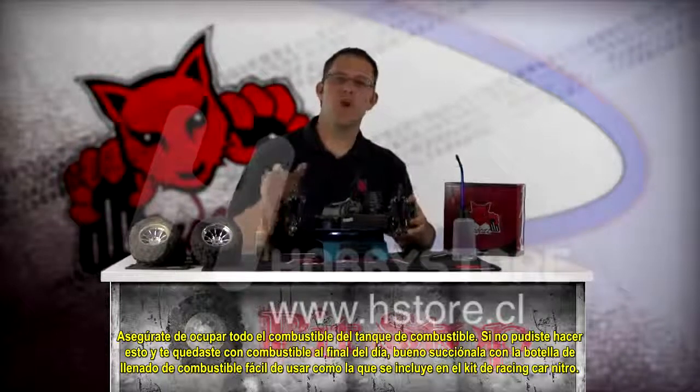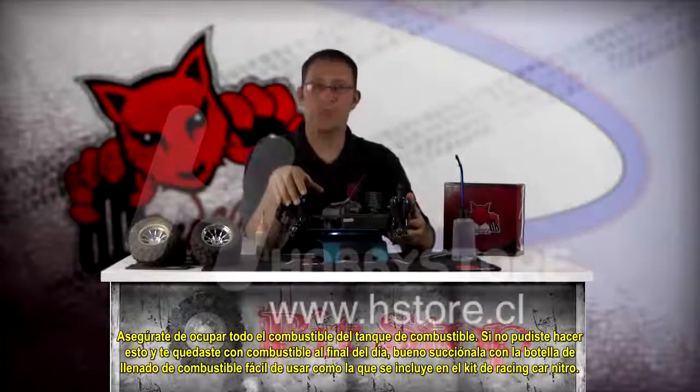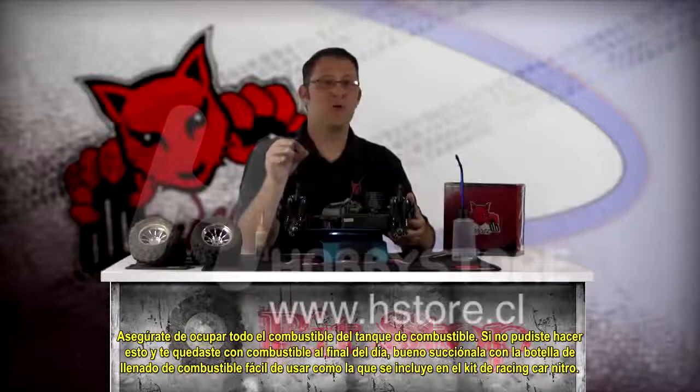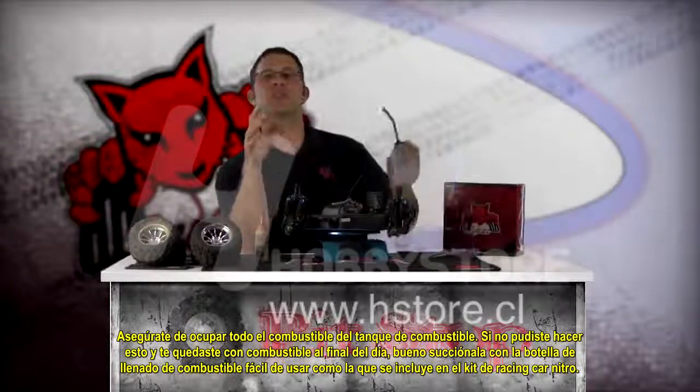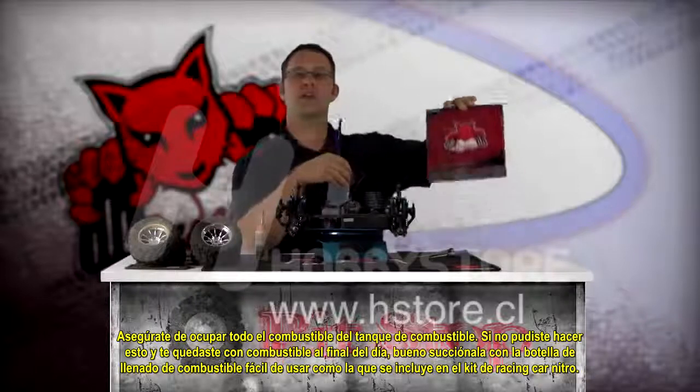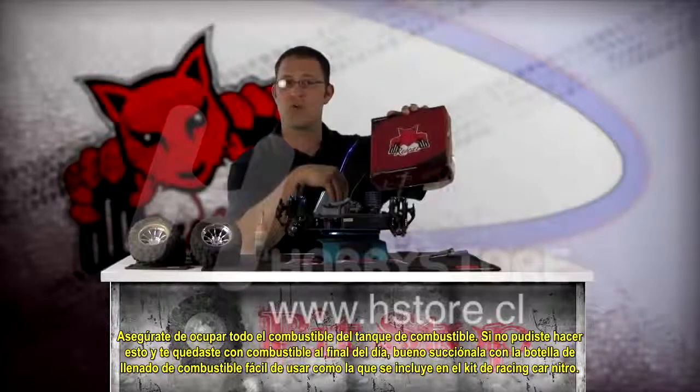Be sure to run all the fuel out of your fuel tank. If you are unable to do this and are left with fuel at the end of the day, well, suck it back out with an easy-to-use fuel filler bottle like the one included with RedCat Racing's optional Nitro Starter Kit.